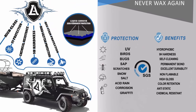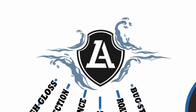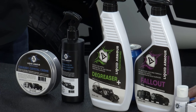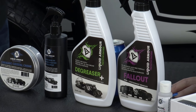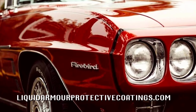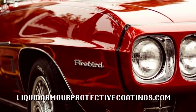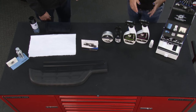When we talk about the hardness of clear coat, this product is almost twice as hard. Most clear coats coming out of factories today, because of VOC compliance, are relatively soft — maybe around a 2 to a 4 on the pencil scale of hardness. Once this coating is applied to your car, it can elevate that to a 9, which is the hardest you can get. So branches scratching or people brushing by your vehicle — you're not going to be getting into the clear coat because our product is going to take care of that.